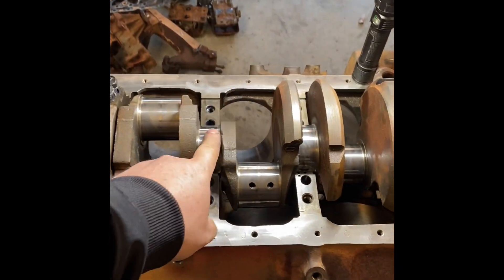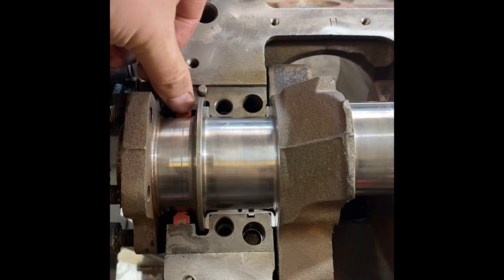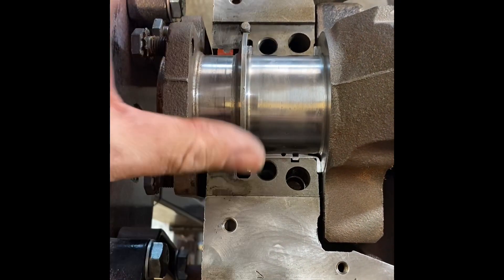I'm not going to check any of the others. I'm going to clean that off, pull the crank out, and put some assembly lube all over it. We'll put a little dab of silicone on our seals and a little additional silicone here to help the rear cap seal.